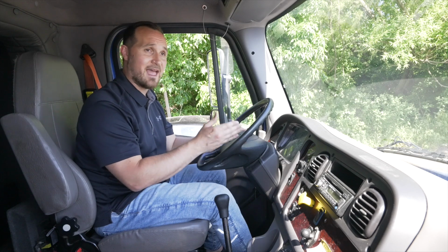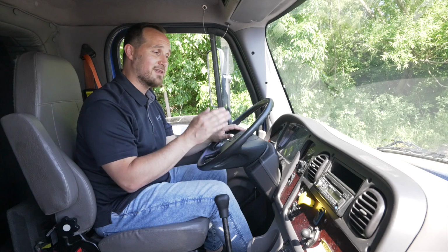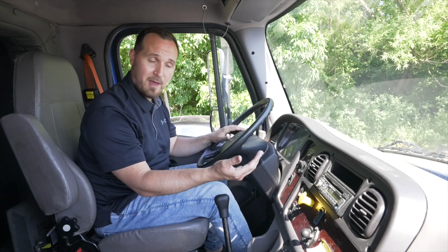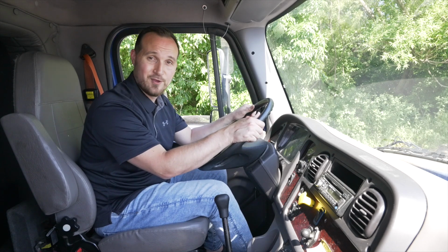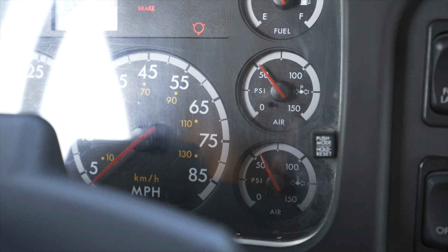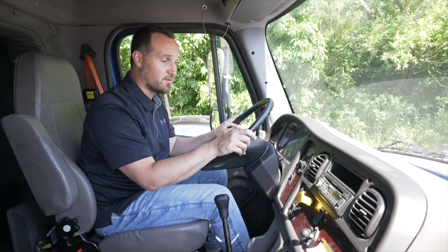Now we're going to do the last and final step, which is the buttons, the emergency spring brake. I'll keep fanning the brake till around 20 to 40 psi till my button pops. When the button pops, that shows that my emergency spring brakes do work. My button did pop. That was a successful test.